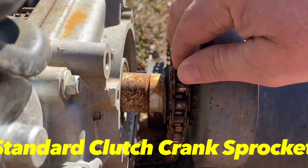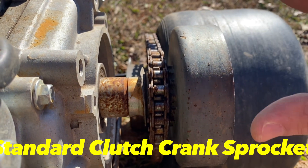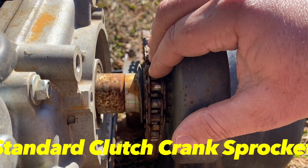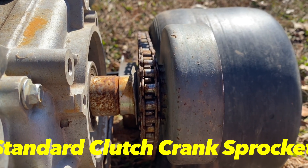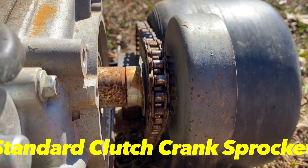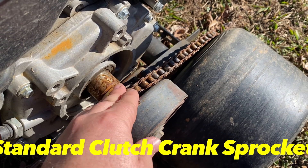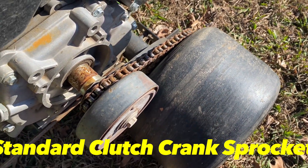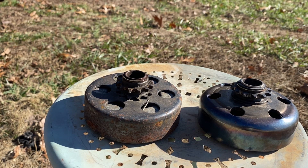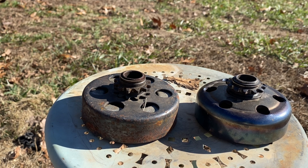Next we're going to talk about clutches and clutch sprockets. For a standard clutch and sprocket, gearing up here on the crankshaft is the exact opposite of gearing down on the axle. A smaller sprocket on the clutch is going to give you more torque, faster acceleration, but a lower top speed. A larger sprocket on the crankshaft will give you slower acceleration, lower torque, but a higher top speed. Another way to look at it is the closer in size that the crank sprocket is to the axle sprocket, the higher top speed you're going to get. They sell different clutches with different sized sprockets — these are both 12-tooth 35-chain sprockets, but you can get all kinds of different tooth counts for different chain sizes.